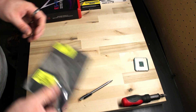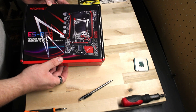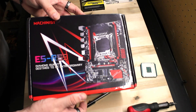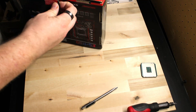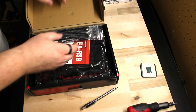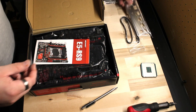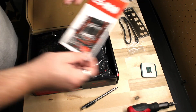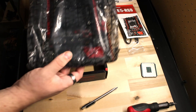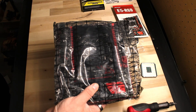Here you can see the CPU out and ready. Next we have our motherboard, which I found on eBay. This is an X99 chipset Machinist motherboard. These come from different makers — from Machinist to a couple other off-brands. You can also find name brands like HP and Asus out there, though they're a little bit more expensive and can really limit your ability to integrate RAM.